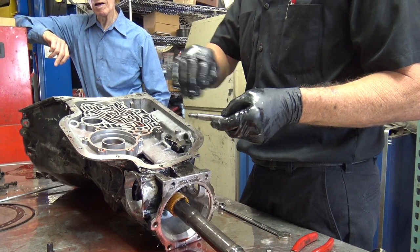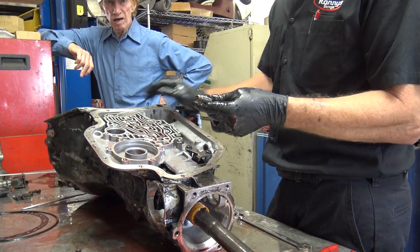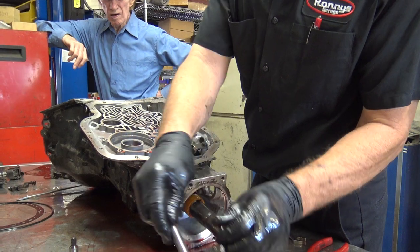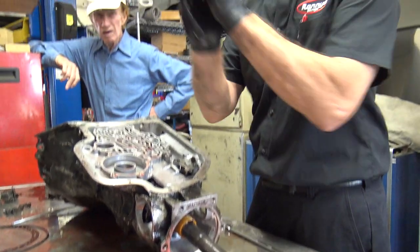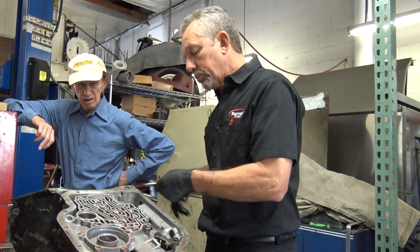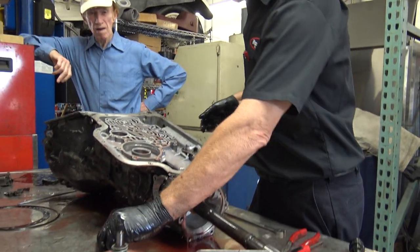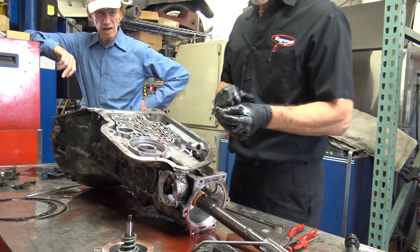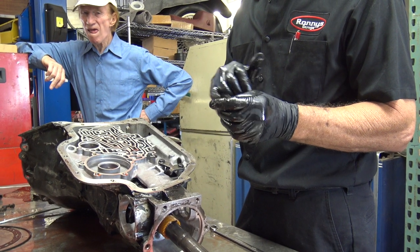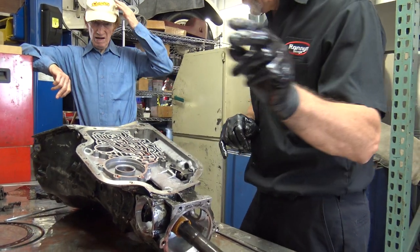If you have a scratch, you can always use some brazing rod — braze that gouge and then finish it back to a smooth surface. It's not under pressure and not super critical, but it does gravity-feed. The reason I had to pound this thing out is that the nut holding this arm on tends to flare the shaft slightly, so it gets a little lip on it. Putting it back in, I'll probably insert the shaft first and then drive the seal in with a driver, which is much easier out of the car. One note to everyone: put some RTV on the outside edge of this seal — just a little around the edge — or I guarantee it will leak.